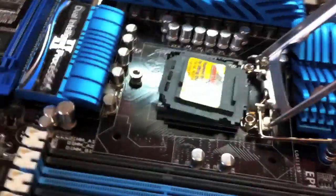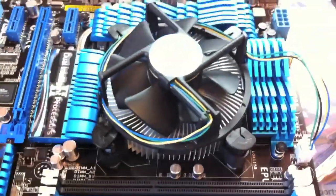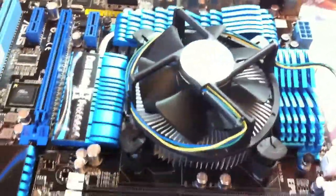Just want to give you a quick open-box look before I go ahead and install it. The next thing I'm going to do is take off the cover, check all the pins, and then install the processor and the heat sink, which is just a stock heat sink that already has the paste on it, so I can just go ahead and pop that on. So I've gone ahead and installed the heat sink and the CPU. The only thing you want to make sure of is whatever side you decide to orient your heat sink to, make sure the cable for the fan will reach. With these stock heat sinks, you just push down on each of the four pins until they lock into place.